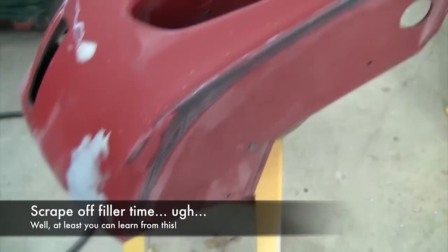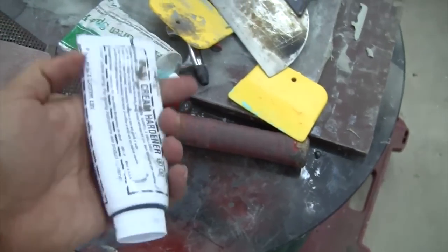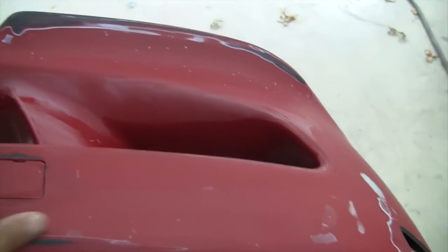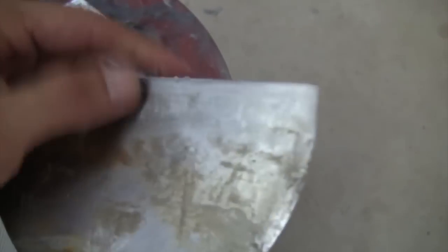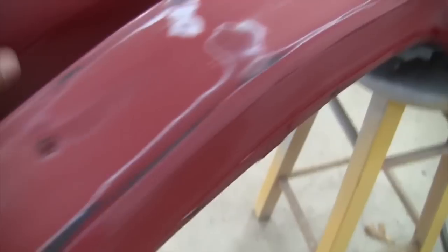I had to video this — I totally screwed up on the body filler on this bumper cover because I was in a rush. This is what happens when you don't put enough hardener in your body filler. I purposely went light on the hardener because I wanted time to lay the body filler on this bumper cover to fill in all the rock chips. I messed up — I didn't put enough hardener in the Bondo so I had to scrape it all off. It didn't dry; it was kind of sticky and stuck on here, so I used a metal putty knife to scrape it off.